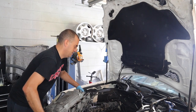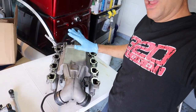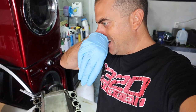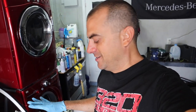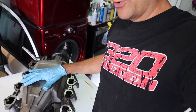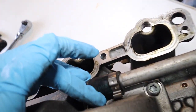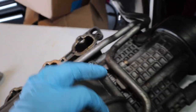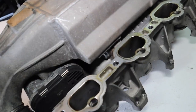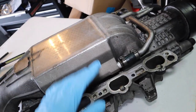I know this is not light. Oh look, I'm finding some goodies down there. Now we got the supercharger off and on the table. This thing is a lot heavier than I remember — definitely beefier than the ones from my SLK32. I'm going to need a helper to put it back on. First thing we're ripping apart is the intercooler — there should be T45 bolts, four bolts here, and two bolts deep in there that are part of the snout but also hold that bracket. I'll mark them so I don't forget. The four short ones are from over here and the two long ones went through the snout and into the intercooler.